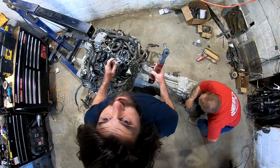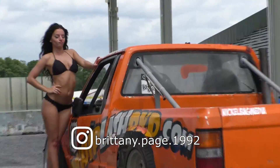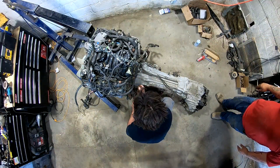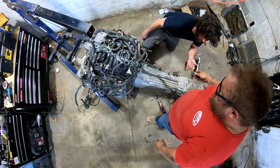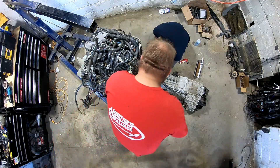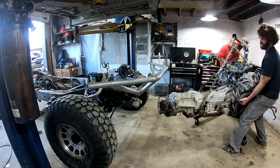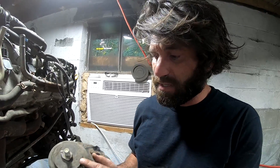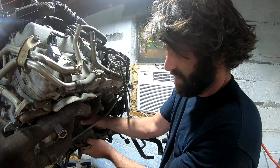You'll like to know that in the drift truck I only had one bolt on each side, because I broke the trans so often I figured who cares — it's quicker and easier to change. Or is that why the trans broke so often? No, that was not why it broke. Before we even drop this in, I'm going to put the Tundra mounts back on this Tundra engine and see how they fit inside the frame. By calculations they should fit; I'm just not sure how much room we'll have around that steering shaft. Hoping these do work because I prefer these mounts — they look a lot beefier.